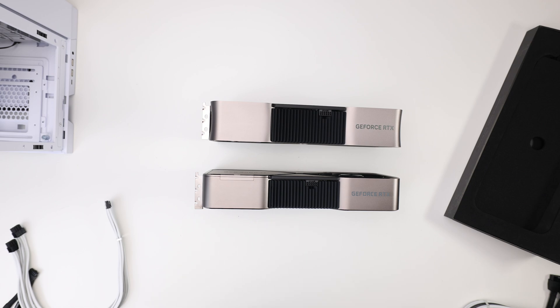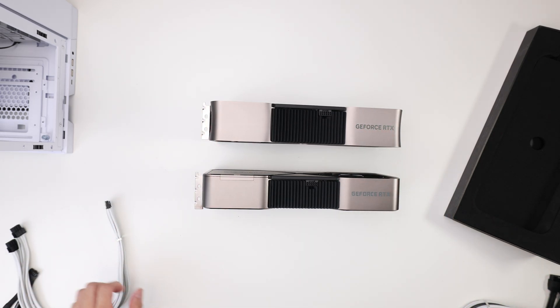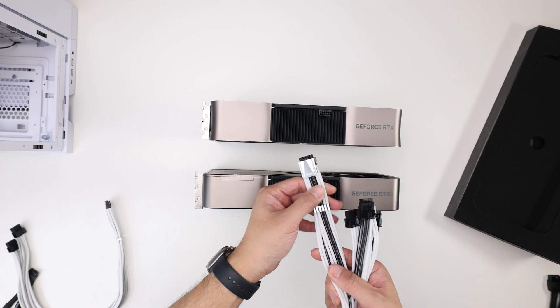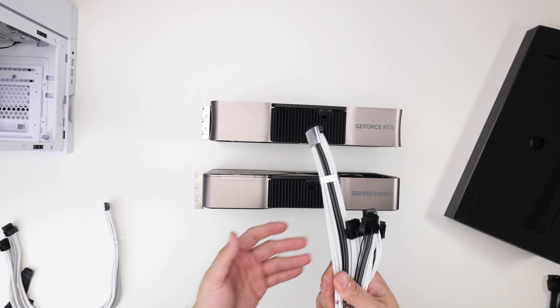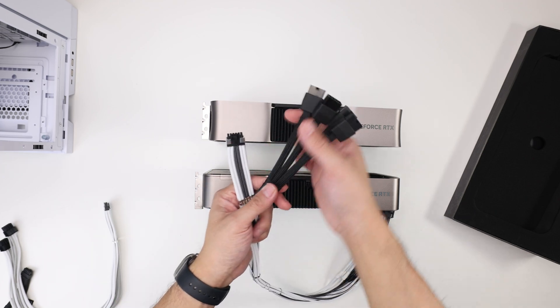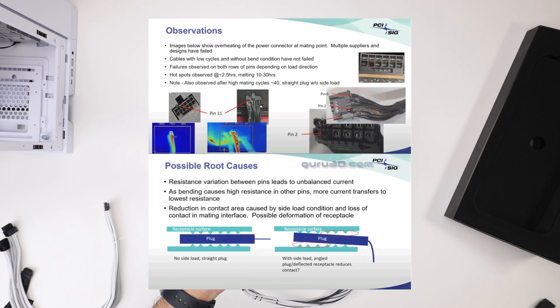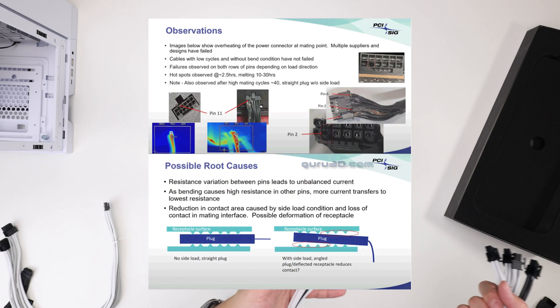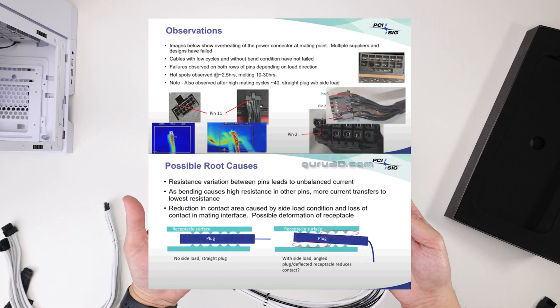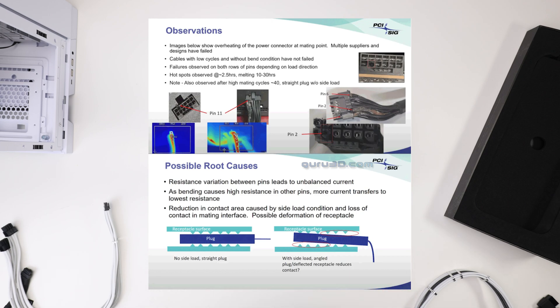With that said, thanks for watching. For anybody getting these cards, I definitely feel the cable mod cable is a safer bet — it's just thicker wire than the adapters and they look better. When you have to clump 4 onto here, there's a lot of stress on that cable. If you add 4 8-pin PCIe connectors to it, it's going to naturally have stress. It sucks — you may have to go out and buy a new PSU to not deal with the adapter, or spend money on a cable mod cable. I hope NVIDIA will hand out 90-degree adapters; that would solve the problem for a lot of folks. Thanks for watching. Take care and stay safe.